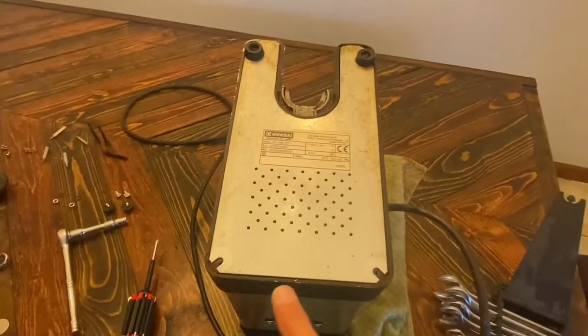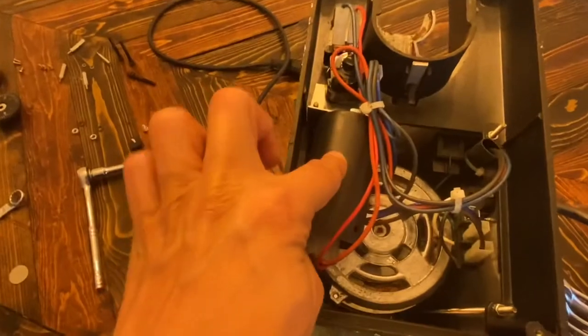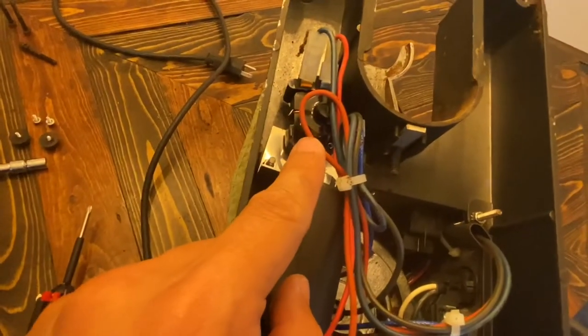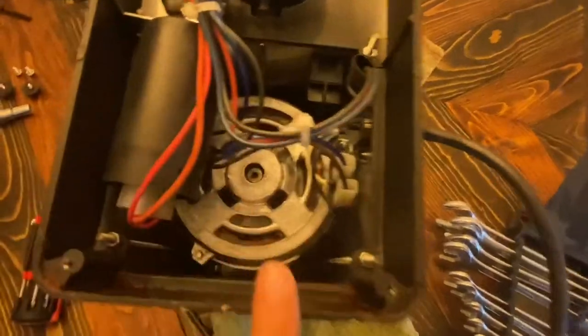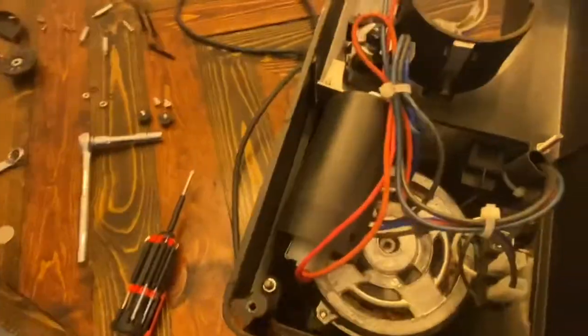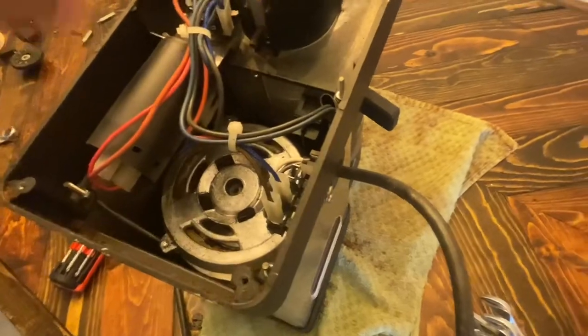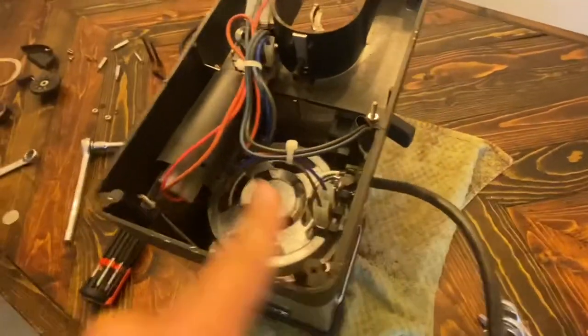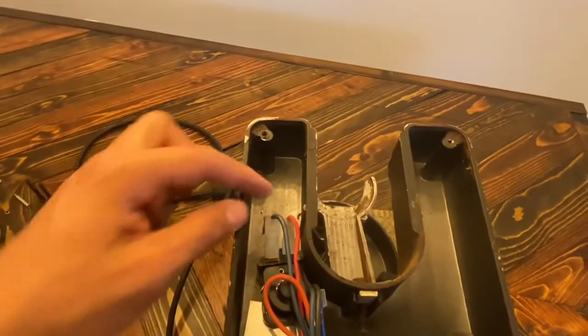All right, let's see what's under here. The skirt is working — there's a mess. In pursuit of progress, I've removed the four screws holding the base. Let's take a look — just what I expected: disgusting. If I had to guess, this is a massive capacitor for the motor. There are two long screws here, probably for the motor mount. There's a massive motor, some connections — I want to be careful not to kill myself since I did just plug this in. The switch goes to power, leads run to the capacitor, to the motor, and there's something else — probably a fuse.